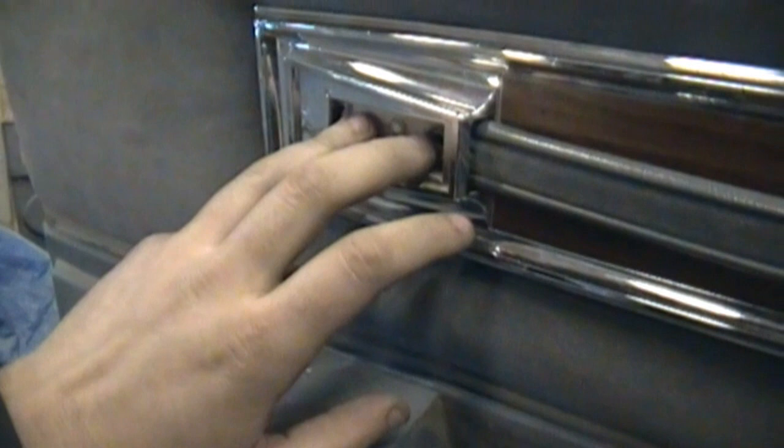When you pop these two covers off - I made a little clip of that too - there are four Phillips head screws in there, and then this will loosen up the whole panel. You don't need one of these but they're nice - a door trim tool. These little tabs: you slide this right back to where your hole is and then pop it. Usually you'll get them out, sometimes they'll break, so it's not bad to have a few extras. There are about six or seven of them all the way around.